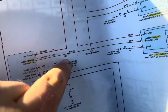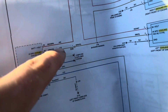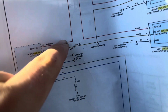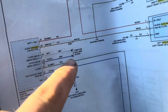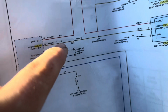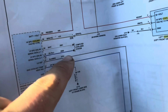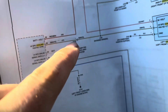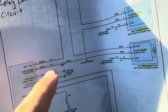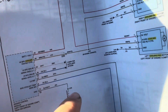And the problem is that this wire from here to here goes through an entire loom, pretty long. So if you want to jumper it, you could do that, but the correct way to fix it is disassemble this loom and find where the break is. For the customer, I just jumpered it because he wanted the cheap way, and the faster way. He needed the truck, and he'll bring it back when he has time. And like I said, if you want to jumper it, that works too.